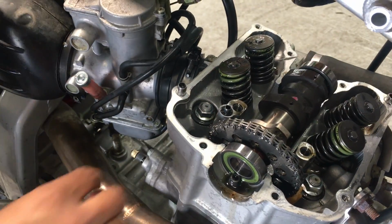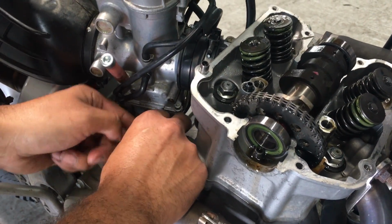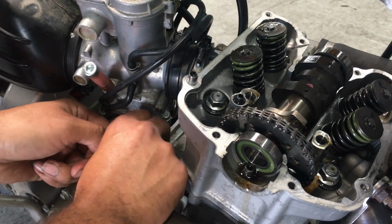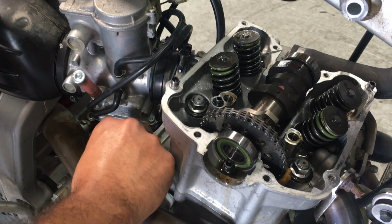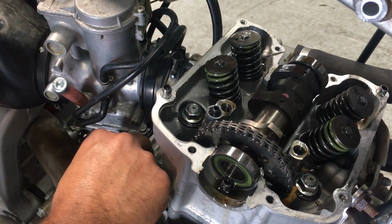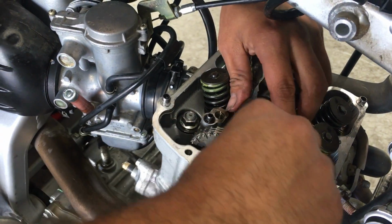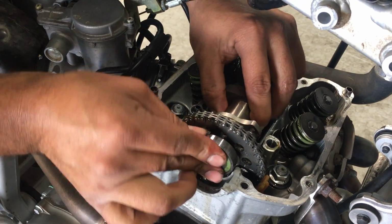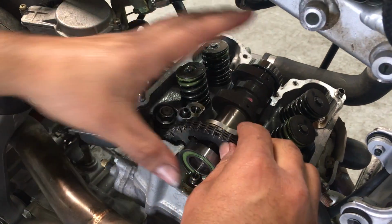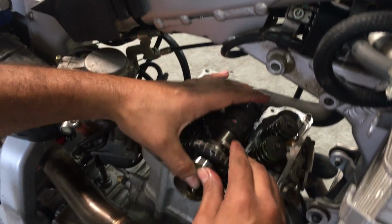But you know what most people do, they'll take the side cover off here, and you've got a snorkel plus another plastic piece. So you take that out so that the airbox can breathe better, and rejet the carb for it. If you have a 49 state bike or a California bike, you have to make sure it has a full-size intake manifold, because some of the early ones came with a really plugged-up intake manifold.